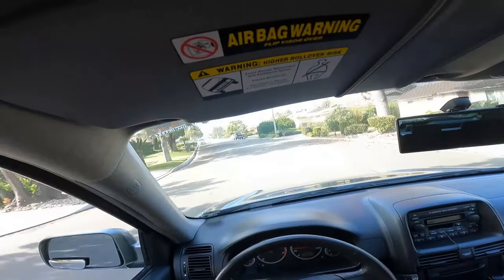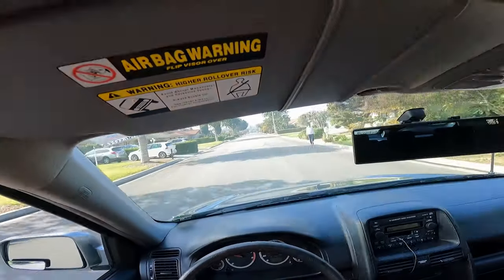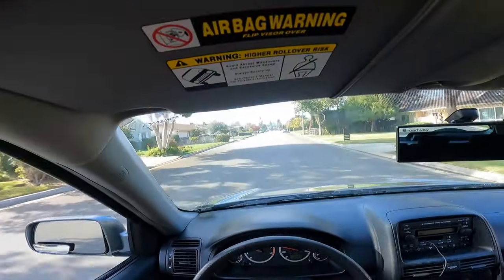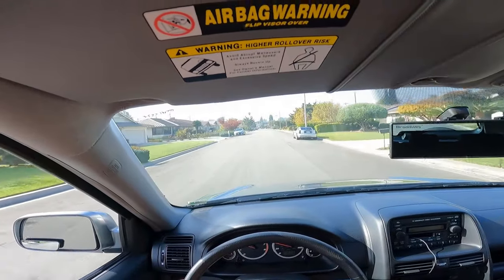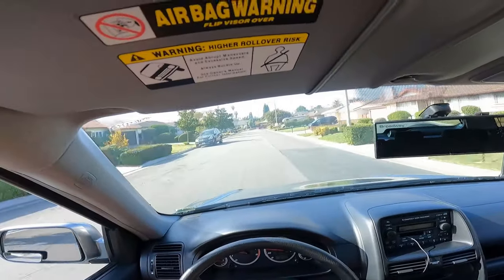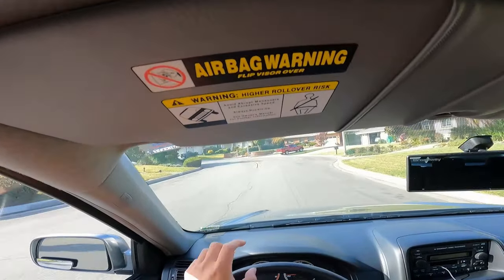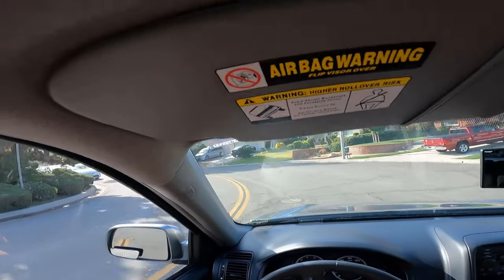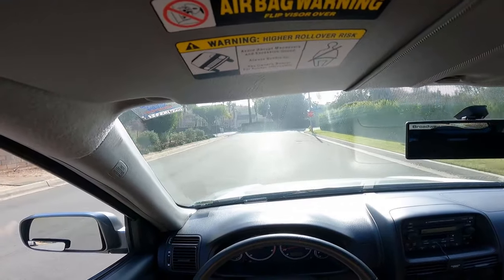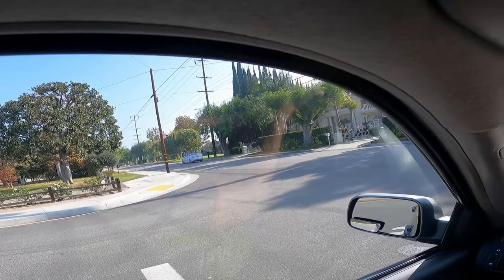This vehicle drives very smooth — that's why I love stick shift. It's fun to drive. If you buy one and the manual transmission feels a little hard to shift in second gear, change your manual transmission fluid and that will fix it. I noticed a couple of people that drove stick shift in this vehicle didn't know that and hadn't changed the fluid, but once they did it made a night and day difference. This thing drives fantastic. If you ever find one in good condition, just hold on to it, because a lot of people that own this vehicle hold on to it. It's already rare enough to find a second gen — the second gen is, in my opinion, better, even though the first gen is more popular.